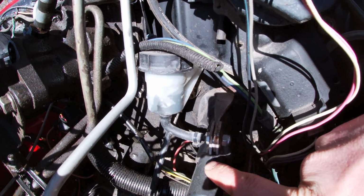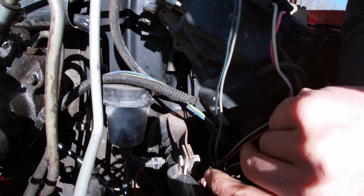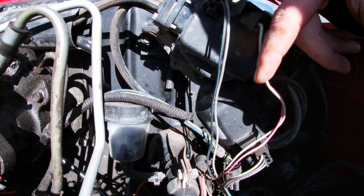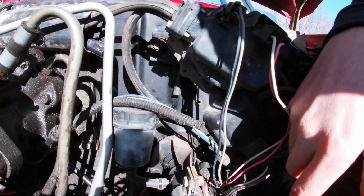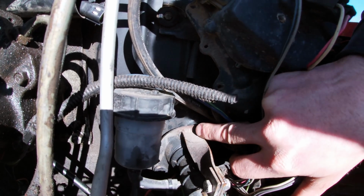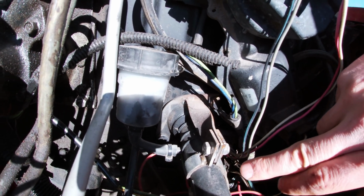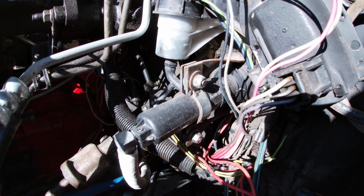And this is the master for the clutch. It only goes in there and does a quarter turn, and I kept breaking the tabs off them. I replaced it once, and then it looked like it was going to break again. I can't remember if it broke again or not, but I thought, well, I'm not going to keep on buying these things just to have them keep breaking. So I got those little things welded on. That's the bracket with the studs that go through the firewall, and then I just kind of twisted those around, and then I just cut a chunk of pipe in half and welded on those tabs and drilled holes through everything and lined her all up.